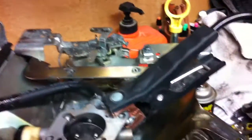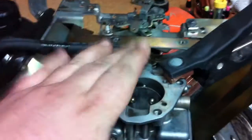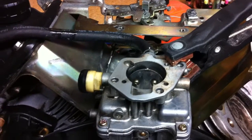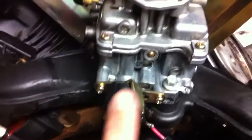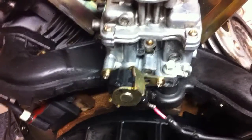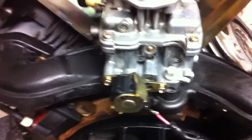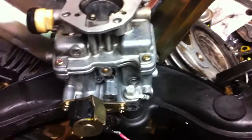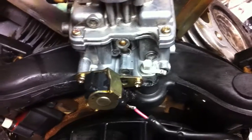So anyway, on to this fuel issue. The fuel issue is: let's say you're getting pressure through your main line into your carburetor but it will not start. There is an actual valve that can shut your gas off, and it's right up here. It's 12-volt electronic, meaning that if you have your key in the on position it will be open, and when you turn your key off it will close the fuel automatically and not let fuel get into your carburetor.